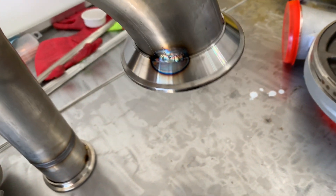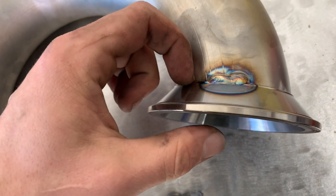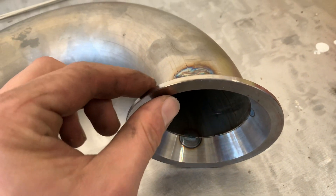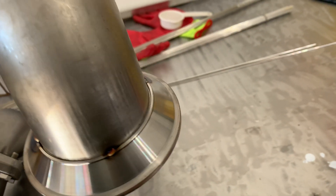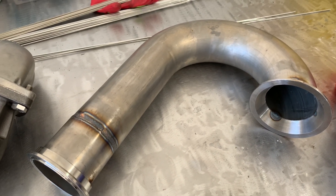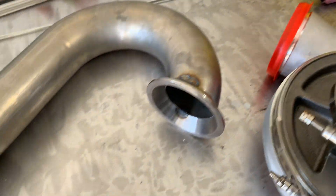This is actually a special flange from Keating Machine — I believe on eBay. It's an HE351 flange that adapts down to three inch. They make several sizes: HE351 to four, three-and-a-half, and three inch. It's a nice billet machined piece. Got a standard three-inch V-band on here. That's pretty much all you need to fabricate — this, and then some aluminum intake from the atmospheric turbo into the intake of the HE351.